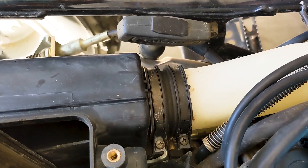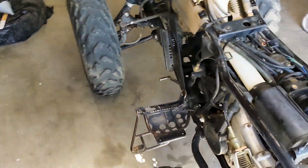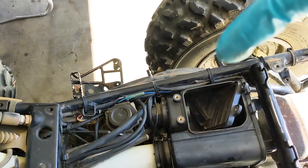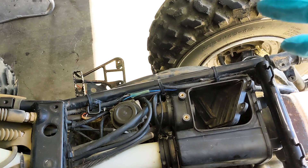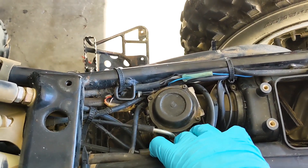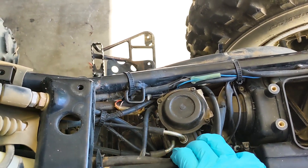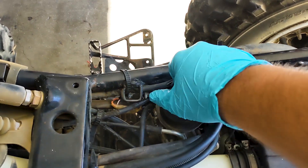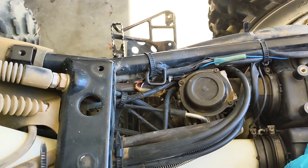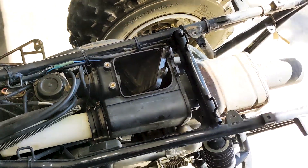I did a recording on cleaning out a carburetor before. It hasn't quite made it to video yet — maybe it has by the time this is posted — but I will record cleaning out this one too. Even though most carburetors are the same, they do have some differences. This is a Mikuni. We got to try to take this throttle cable out, and I think that comes off on the side over here, so maybe we'll have to take that cover off. Some of them have just a screw-off top like on most dirt bikes, but this one doesn't.